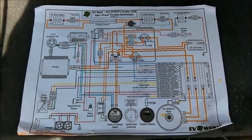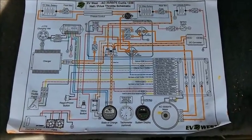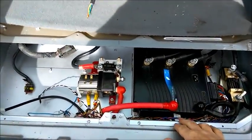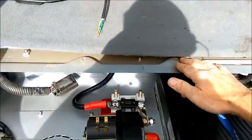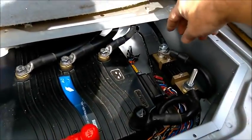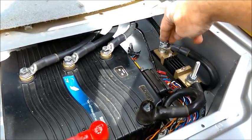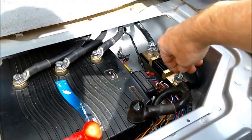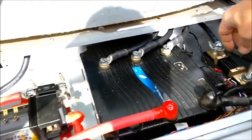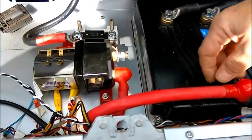So this diagram is the most useful diagram I've found in terms of taking a standard wiring that somebody else has created before. I've got the tray fixed in now — that's all properly in, all bolted up. I've got the controller in and the zero volt bus, and I'll put a shunt in. The main zero volt comes in there from the battery and then off to everything else. I'll put a long stud on here so I can connect loads of zero volt things.